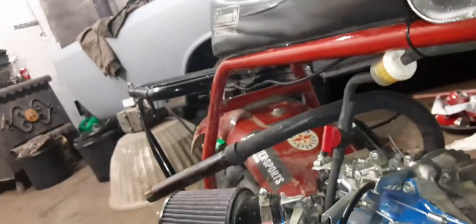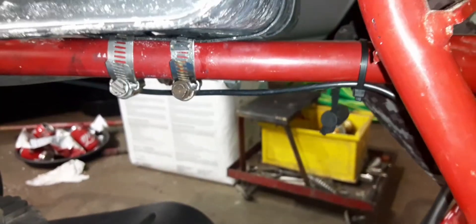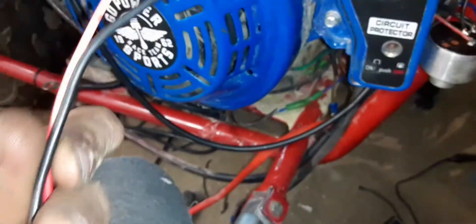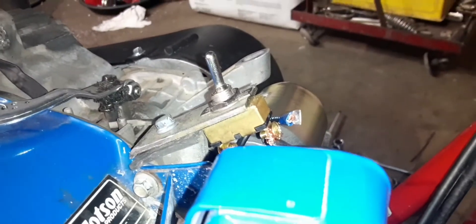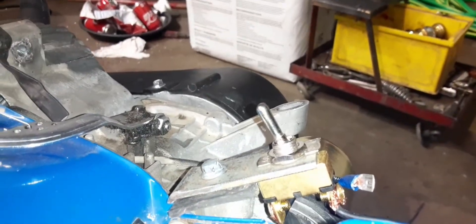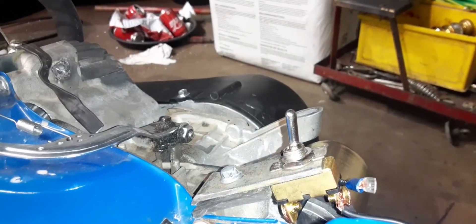I had no problem with my rear tail lights — it was just the front one that was causing issues. I don't have a lot of wire so I'm not using red for hot everywhere, but this is the hot wire for the tail lights and this red one's the hot and ground for the front headlight. I had them wired to a toggle switch and everything was okay — the rear lights worked fine. But for some reason, when the switch was off, the headlight was still on, just dimmer. So it was on in both positions, just dimmer in one.